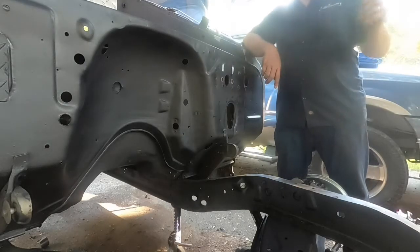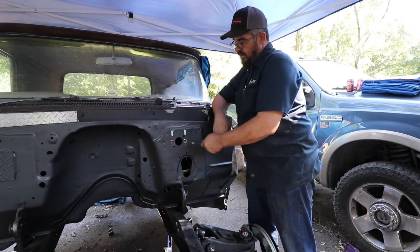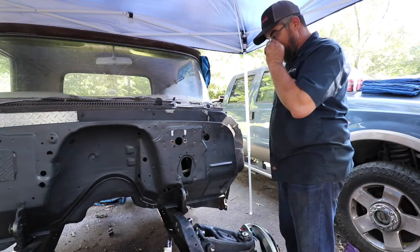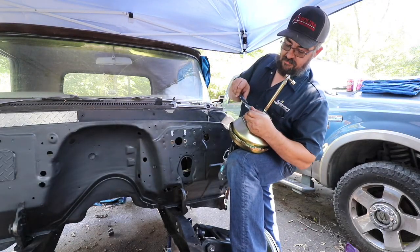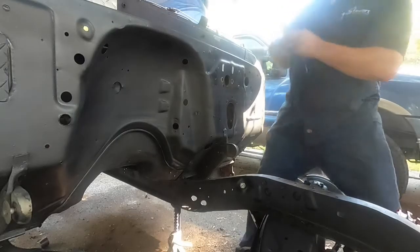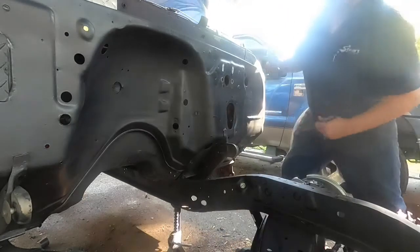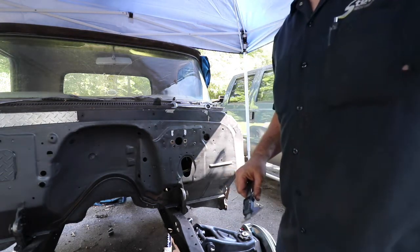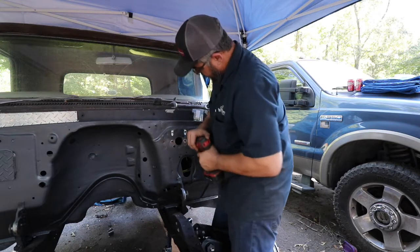My daughter is an amazing artist and she had some white acrylic paint — the only thing I could think of without making a mess of the whole firewall to mark the upper slots. I'm going to get a pen and my dial calipers and figure out how to do this — measure the difference from the bottom of one to the bottom of the other so when I tighten the bolts down I'll have the same adjustability. I'll measure from the middle of one hole to the middle of the other, grab a line, X marks the spot. Get a center punch, punch those, drill it out with a little drill bit, then go to the right size.